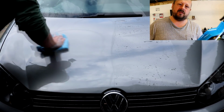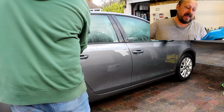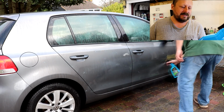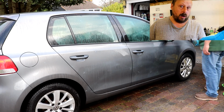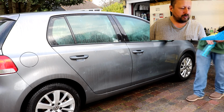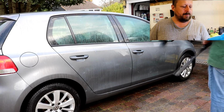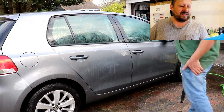Your initial one, where they suggest you spray onto the car after washing and rinsing and then work it over each panel with a cloth. So effectively you're kind of buffing it into the panels on your car and glass, because they say all exterior surfaces. So we'll talk about that later on. Once you've done that initial application, a couple of months down the line, or when you feel the need to reapply it, you can spray it on after washing and rinse it off. So let's go to that step 3.